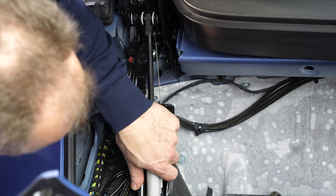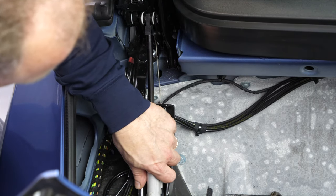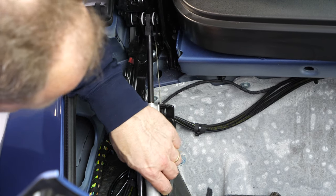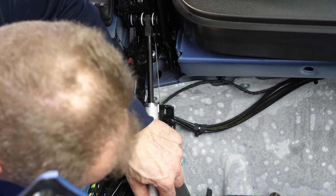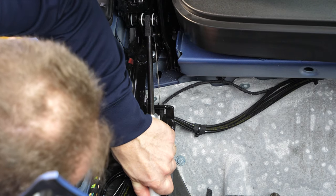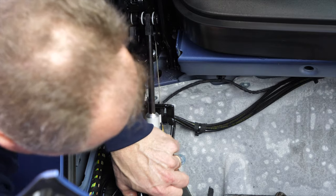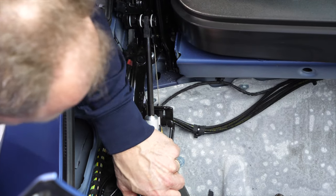Now notice that this pin is a little bit wedged, so we may have to massage and pound on it a little bit to really get it through the bottom of the cylinder. Now I will also try to insert the washer together with the cylinder and need to create enough clearance here. So if we put both in together, we use a small screwdriver first to wiggle around here and line everything up properly, then we'll use a slightly bigger one just because that'll line it up better. Then it's down to getting the pin through the washer.